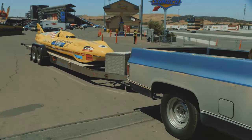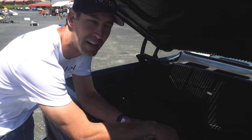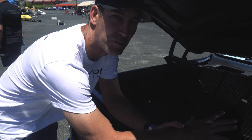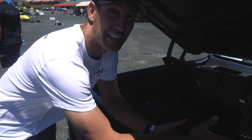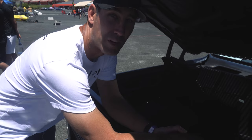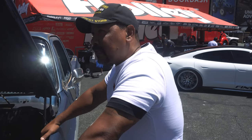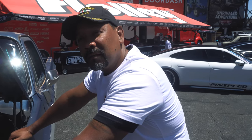I got enough battery in this thing to move a building. The battery in this vehicle actually came out of the Little Giant triple four car, which is the fastest electric car on the planet. That battery was designed to sustain 3,000 amps to motors. Being able to hit something with that much voltage on a motor like this, it's only using half the amount of current — we barely even saw a voltage sag yesterday after full throttle. With your new controller, we can really see what it could do, because I don't know anybody that's run a battery this stiff on an LDU yet. I'm expecting anything over 10 seconds in a quarter, I'm going to be disappointed.